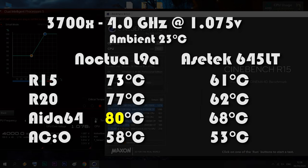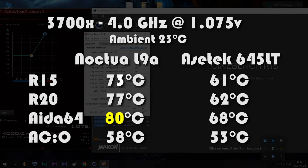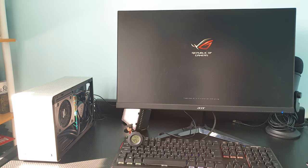Well now, with this information under the hood, let's overclock the CPU and see how much we can squeeze from it. Spoiler alert, I even managed 4.5 GHz for exactly 1.395 volts, and it did manage to pass a run in Cinebench R20 for 5002 points, which is incredible, but it failed in the stress test, meaning it had spikes of 102 degrees, and after a few seconds I closed the test again to protect the system.